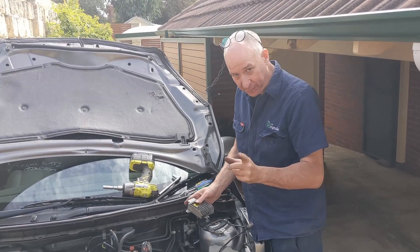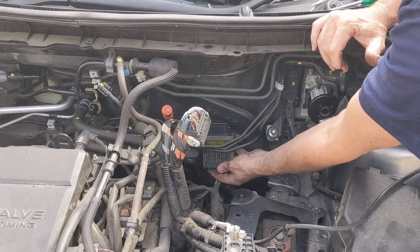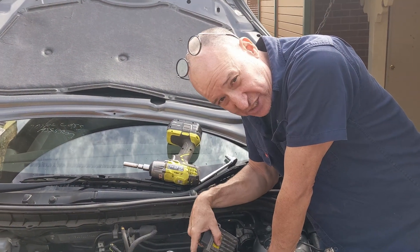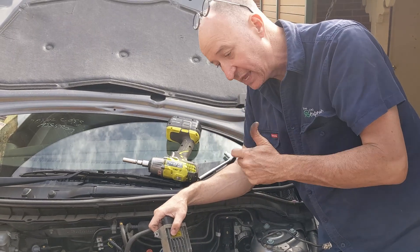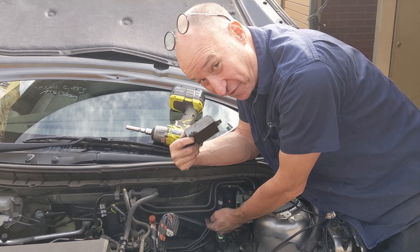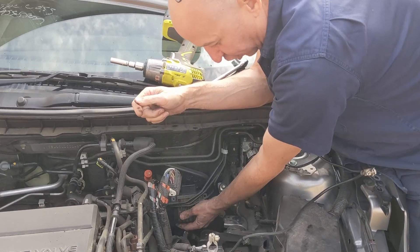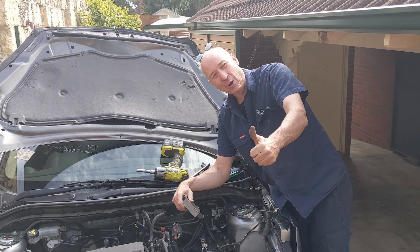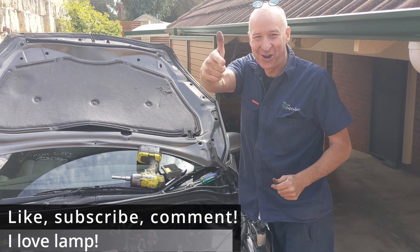Reinstalling is just the opposite of uninstalling. One variation I've seen is to cable tie it to the brake lines on the firewall instead of bolting it back on top of the transmission. The reasoning is that transmissions get hot and electronics don't like heat — on the firewall there's more airflow and it's not bolted to something getting hot. The firewall is actually quite cool despite its name, so it's a decent place to mount it. That's how you replace a TCM on a VL. If I've helped you, please click like, subscribe, leave a comment, and share your knowledge — thanks from Paul in Perth.